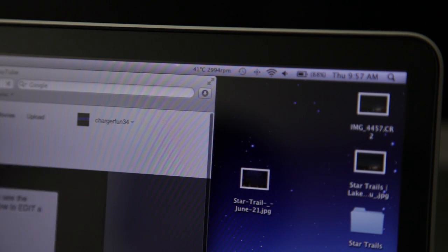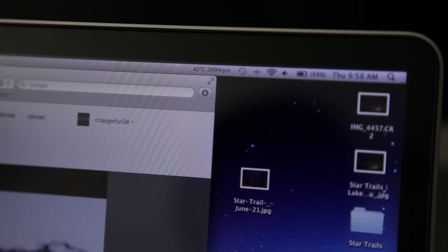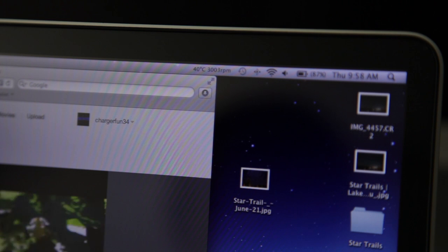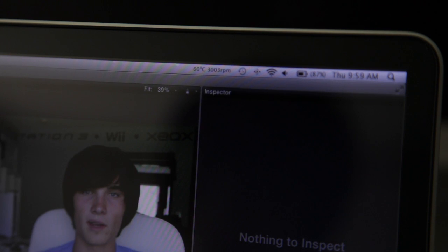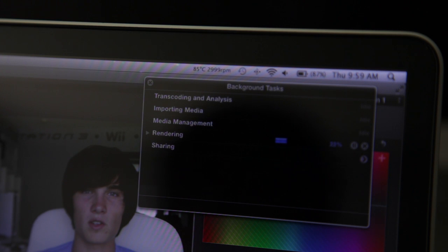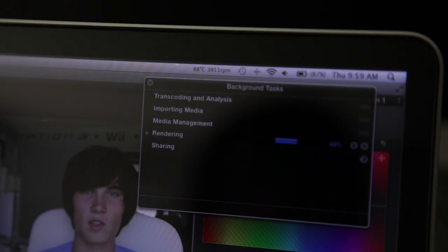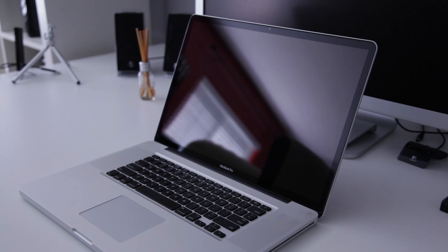Okay, so this is after dusting. Now I'm watching almost the same video in 720p, and as you can see it's way cooler — about 5 to 6 degrees Celsius cooler, and that's just from dusting. Now in Final Cut Pro 10, doing the same color changes and rendering, it hovers around 88 to 90 degrees Celsius instead of reaching 92 to 95 degrees Celsius — so like I said, it is a 5 to 6 degrees Celsius change. Thanks for watching my video. Goodbye.